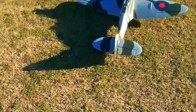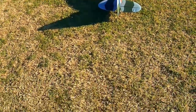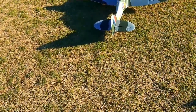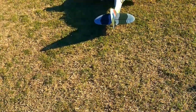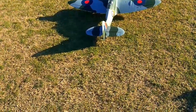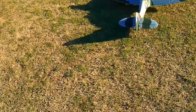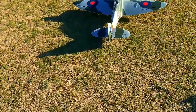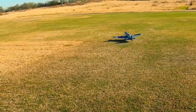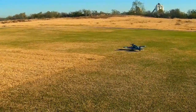This is flight number two of the Spitfire from E-Flight. First flight went okay, but it seemed like it was underpowered. Looking at a couple of other YouTube videos, I'm sticking a 4-cell 2200 in it. Standard factory 40-amp ESC and the 15BL motor. Mid-rates on the ailerons, high rates on the elevator and rudder. Still about 39 degrees, wind's out of the northeast at about three miles an hour.